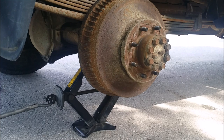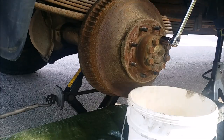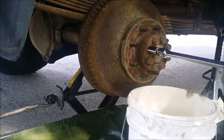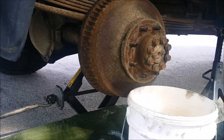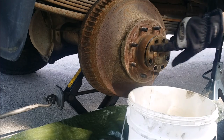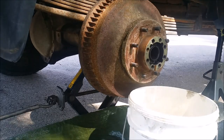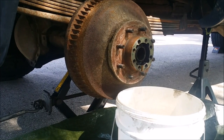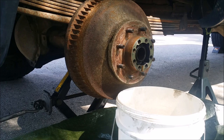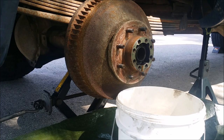A breaker bar works really well for these axle bolts too, because they likely have not been pulled off often, if ever, on your truck. If the axle is stuck, lightly tap the front end of it with a hammer and it'll pop right off. Once it's out and drained, wipe off what's left on the outside of the drum with a paper towel, then you're ready to pull the drum off - the lugs are attached to the drum so just pull on that ring.